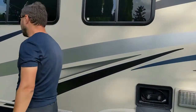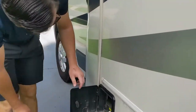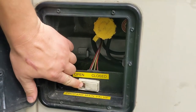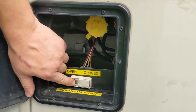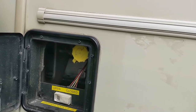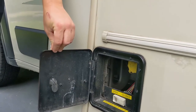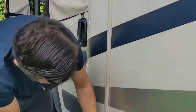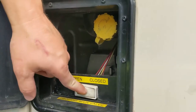A few more things on this side: propane refill. This is the port, and this is the propane valve — open and closed. If you need to refill propane, which usually happens in the fall when you use a lot of furnace or on a long trip, just pull into a truck stop, gas station, or campground with propane refill. In this company we don't allow self-refilling. Just go to the register, say you need propane — they'll ask all travelers to vacate the vehicle and confirm all pilots are off. Closing this valve will automatically kill any pilots.